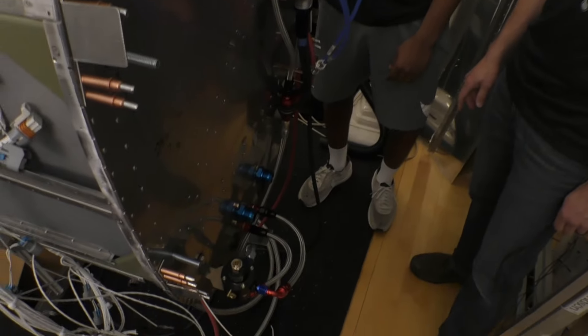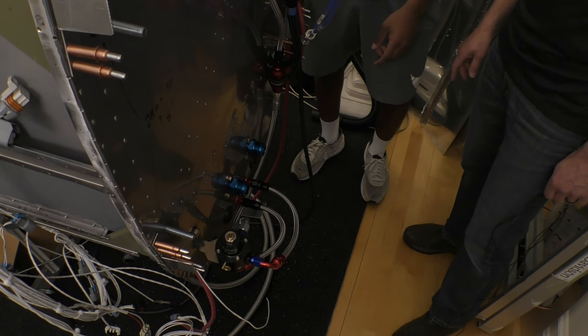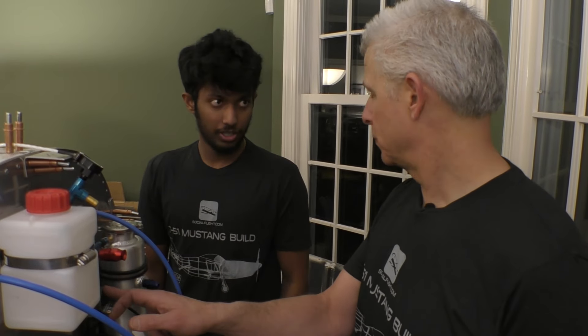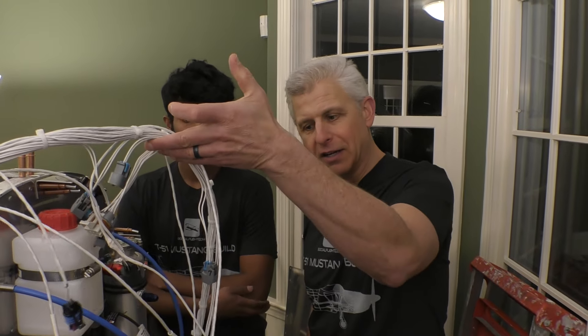Tell us about some of the components that you put on here and how you figured it out. After the manifolds, I put on the expansion tank and the fill tank for the coolant — the overflow tank. I put the fuel pressure regulator on, and the fuel pressure regulator bypass goes back to the tanks but also goes into the fuel rails. We've got our fuel filter all the way up, and the fuel flow sensor, of course, that goes onto the Bendix King and JPI engine monitor. One of the things that's also part of this is we did a lot of figuring out for the computer and the harness. This entire harness that you see here is ready for the engine to bolt on now — it's all been wired up to the computer, everything set up. We even loaded the program, so there's a lot of stuff that's just ready to drop in now, which is really exciting.